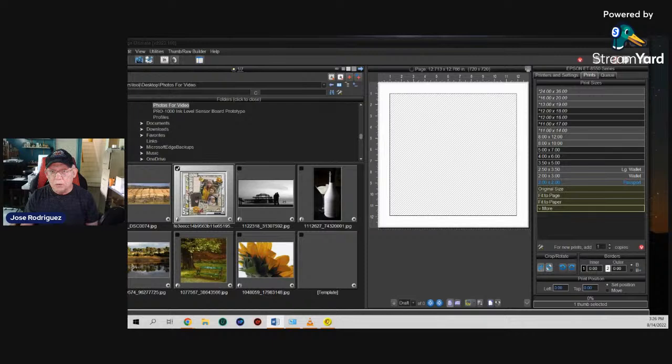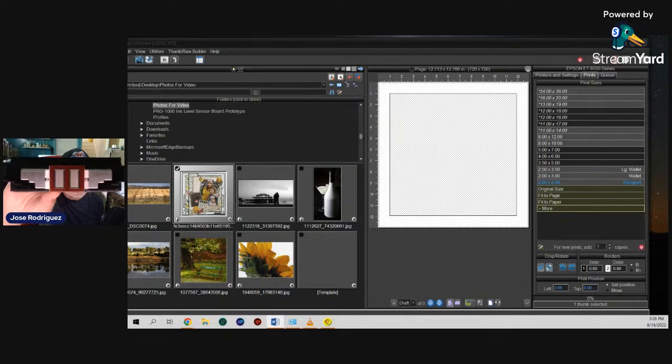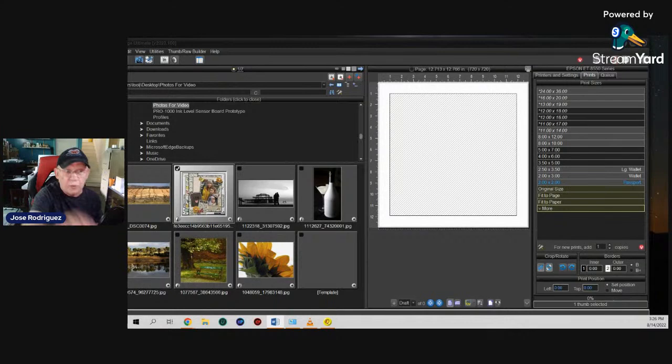On the Pro 10, the Pro 100, you have two groups, group one and group two. On the Pro 100, it's obviously 8 colors, so the first group is 4 and 4. Pro 10 will be 5 and 5. And you can see that very clearly here. You can see that the nozzle plate is subdivided. Now, the purge unit is able to apply suction on the chosen one because it has also been compartmentalized or subdivided. It's really neat. I wish Epson, listen to me, you need to do this. You need to include this in your printers, please. It's crazy.